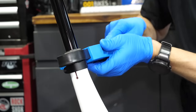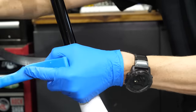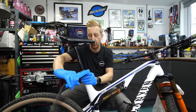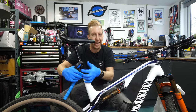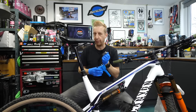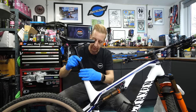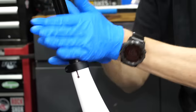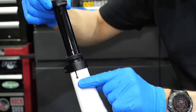A strap wrench is a great thing for holding and gripping on the seal head. It can be quite slippy because of oil and things — think of it as a workshop spec version of what grannies use to open tins. If you haven't got one, get one — they're absolutely brilliant. Just undo this seal head by hand now, there are quite a few threads on it, and then slide it up and out of harm's way.